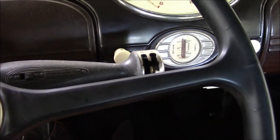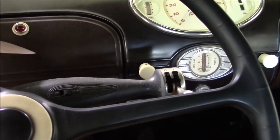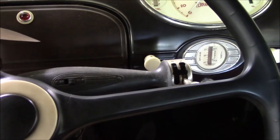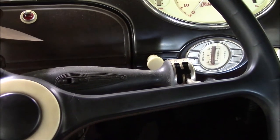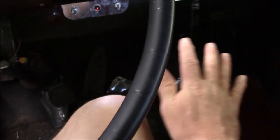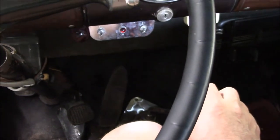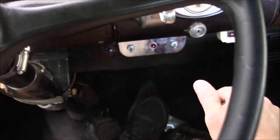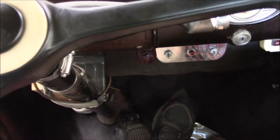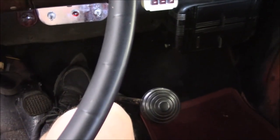Like I said, it was kind of a neat system, but this one was trouble-prone when my dad got it. This transmission isn't synchronized — synchronization wasn't popular yet in 1936. Synchronization is basically when you shift gears, they go in nice and smooth. With this transmission, you've got to work it a little bit. When you downshift from third to second, you have to double-clutch, like an old truck. Double clutch means: push the clutch in, shift to neutral, give the engine a rev to bring engine speed concurrent with the rear end speed, push the clutch back in, and make your downshift. If you do that well enough, you won't get a crunch.